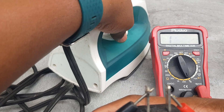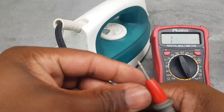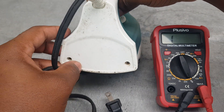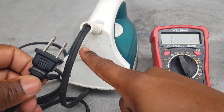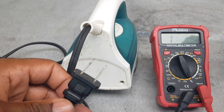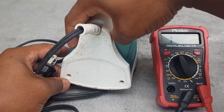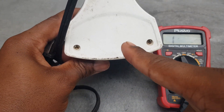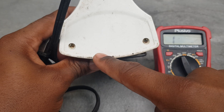As you can see, nothing on the meter. We're going to go further into the iron by pulling the back screw here first and check the cable. I'm going to check from the plug right to the back, and then we'll move further on to the iron. Stay tuned for that. First we're going to pull these screws - I don't have the right tool so I'm going to use a flathead screwdriver terminal type and unscrew these screws.